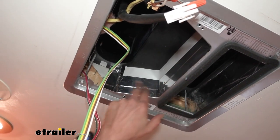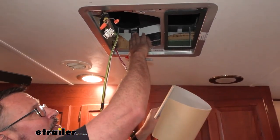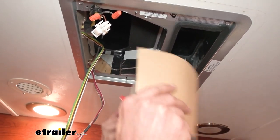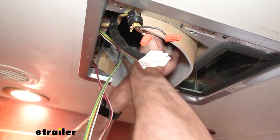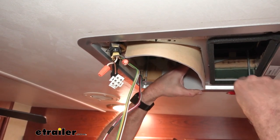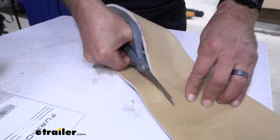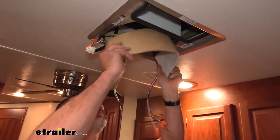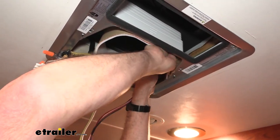The next step involves something not included with the kit: foil duct tape. You can pick this up at home improvement or hardware stores. It's really sticky stuff made for environments like this. We're going to seal up the upper duct divider we just installed — run tape along that seam and anywhere else that cold air can mix with warm air, making sure these two compartments are completely separate. Also in the kit, they've provided condensation foam. We're going to put this on the inside to cover what we just did. It keeps condensation from eventually seeping in and ruining things. The kit comes with enough to cover both sides, but we need to cut it to length, so I've got a Sharpie to mark what I need to cut. Then peel the backing off and set it up.